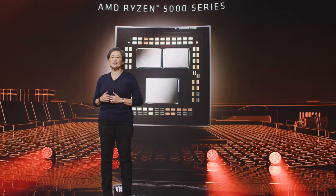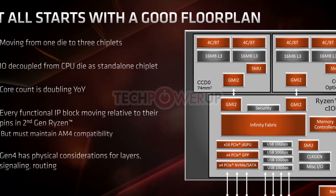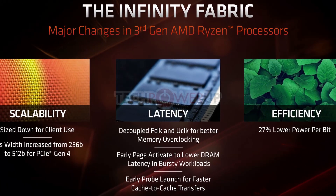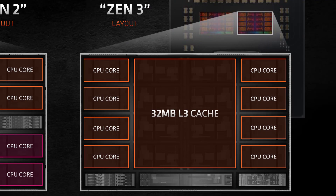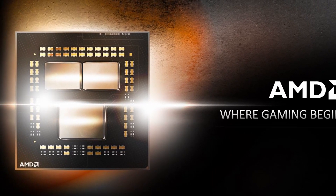Before we get started, let's look at some of the constraints we'll be facing. A Ryzen 5000 CPU consists of multiple chiplets — dies with specific functions such as CPU cores, IO hub, memory controller, and so on. All chiplets communicate with each other via the fabric interconnect. A core chiplet die, or CCD, is one of the chips on the AMD CPU. While a CCD used to consist of two CCXs paired together, on Zen 3 a CCD consists of a single CCX. The core complex consists of eight individual cores, each with their L1 and L2 cache, and they share a large 32 megabyte L3 cache. The Ryzen 9 5900X has two CCDs, each with one CCX.